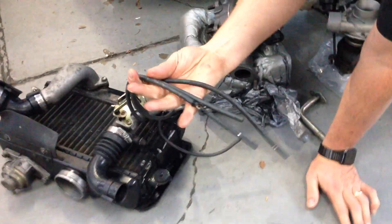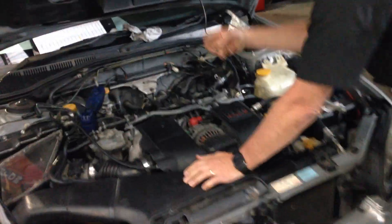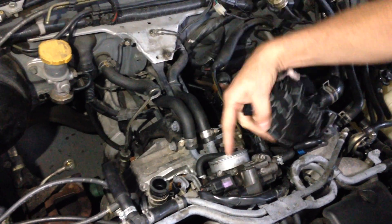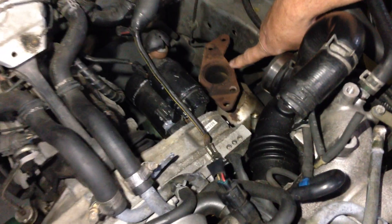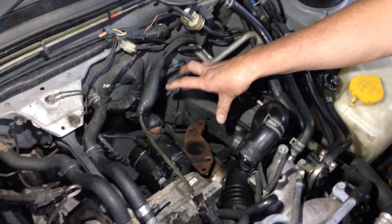As you can see, these are just some of the boost control and actuator lines that are critical in the way the engine works. Let's have a look in the engine bay to see how things fit, because like all Subaru EJ series engines, you've got a single throttle body here with the intercooler sitting here, and the single comes out of the intercooler and fits in there. Down here you can see the driver's side exhaust manifold, which is the secondary turbo, and the passenger side primary turbo, which is the up pipe that that one bolts onto. So this is the side that's got the integral wastegate, and this is the side that doesn't.